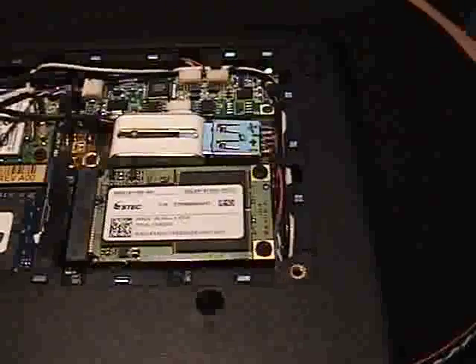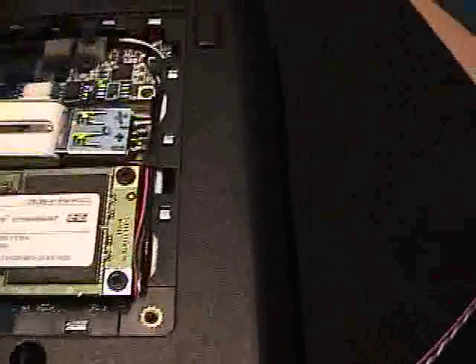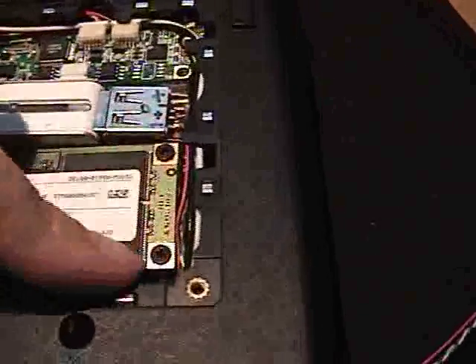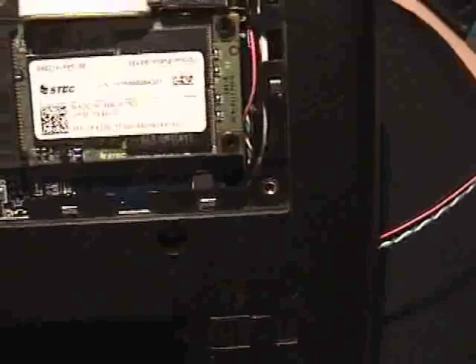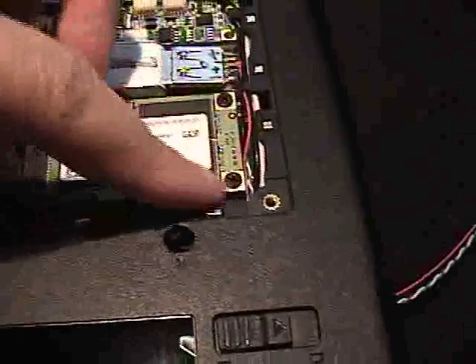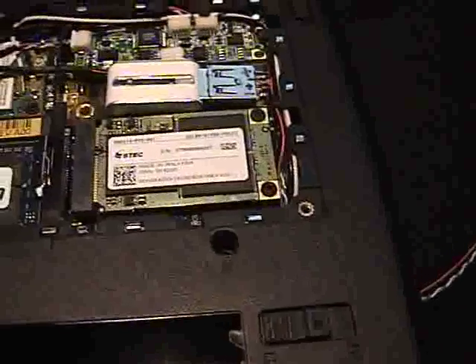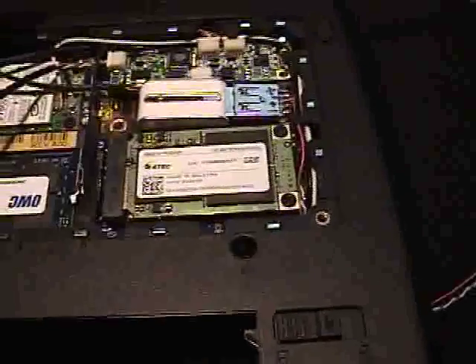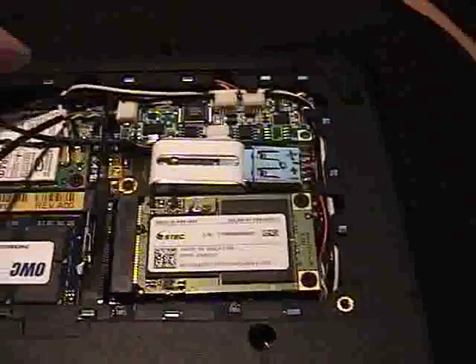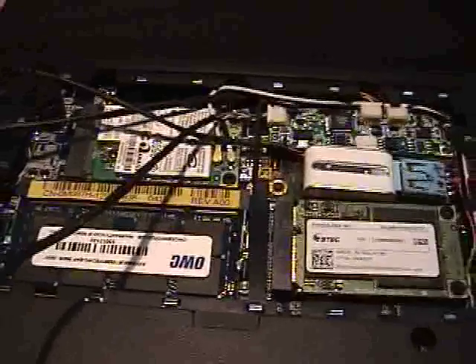One key was routing the wire that goes to the touchscreen this direction here and through the hole where the wireless antenna wire goes, right in the center of the hole. This way there wasn't anything binding around the edge of the motherboard. There is another wire that comes from the camera port on the motherboard that's running underneath here.